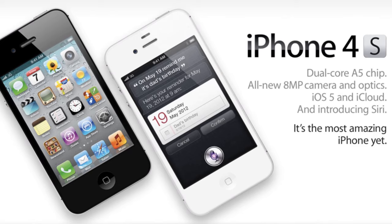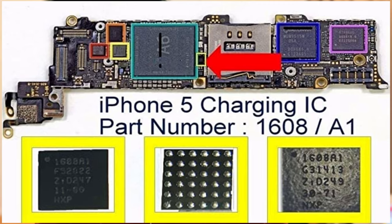For the end user, you might think: why is the iPhone like this? Please don't think that way. Because with other smartphone brands, when they get damaged, the power IC itself dies — meaning the whole phone becomes dead when plugged into that kind of charger, just once is enough, and you can't power it on at all. It is because in iPhone, they had this kind of problem a lot before — especially in iPhone 4, 4S, and older. Ever since iPhone 5, they built another IC on the motherboard — this IC is the TriStar I replaced earlier.